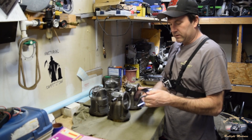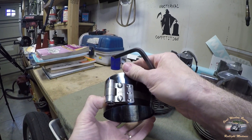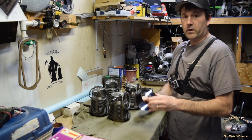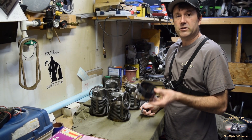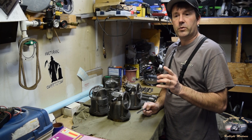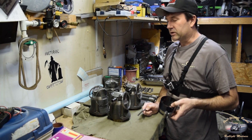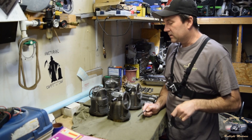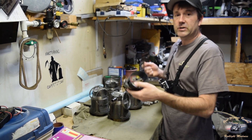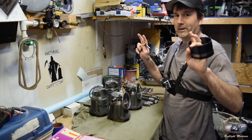Like I said, this is universal. It doesn't say what size on here, but it does say it's made in the USA — bonus. I believe it'll go up to a four-inch piston, and I've hung as small as a 77mm piston, which is a stock piston for the early single-port 1,200cc air-cooled engine. I pretty much hang mainly larger displacement pistons because I build more performance engines.